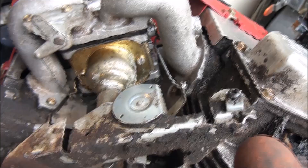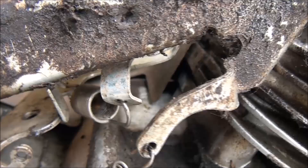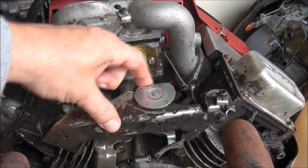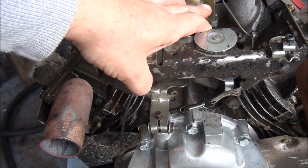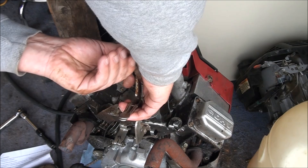That's how the larger spring connects back in there. What the manual states to do is hold this into this position — you can feel the spring resistance — and then you turn the governor shaft clockwise all the way, and then lock it into position by tightening this bolt. I think what I'll do to make life easy on myself is put this in position and then clamp it so I don't have to worry about holding that.